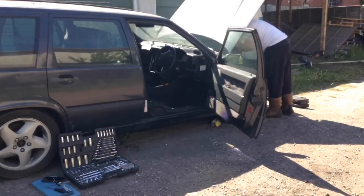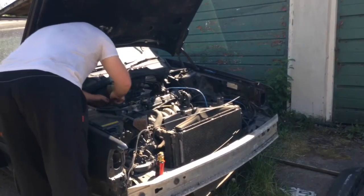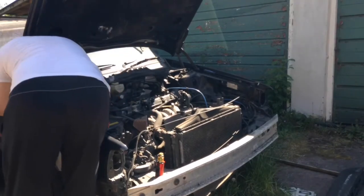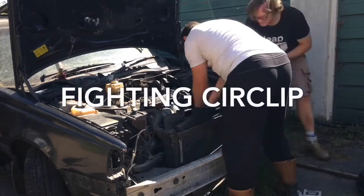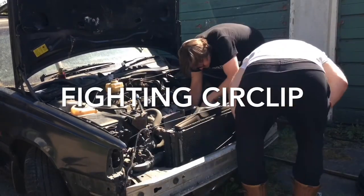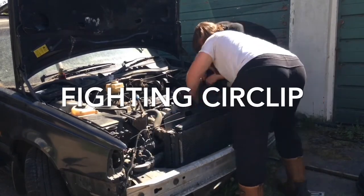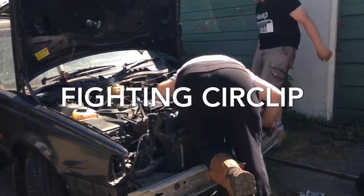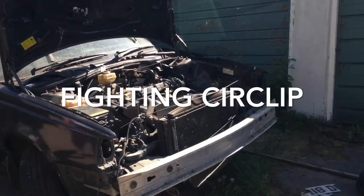This was a little bit fiddly because the clutch master wouldn't pull straight out of the bulkhead — it was slightly stuck behind the brake vacuum servo on the bonnet side. Once that's done, down to the front of the engine, just between the engine and the gearbox, right on top of the starter motor — which is slightly annoying — is the clutch slave. That comes out by removing a circlip, or as Volvo like to call it, a snap ring. Which is ironic — because it snapped.